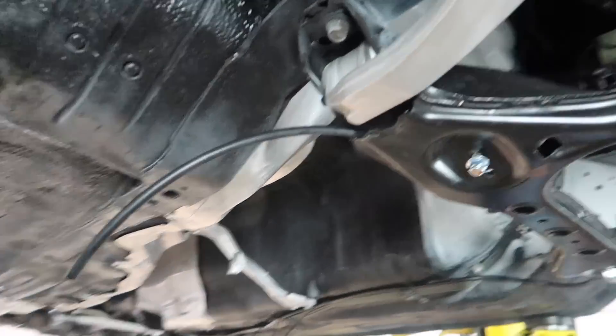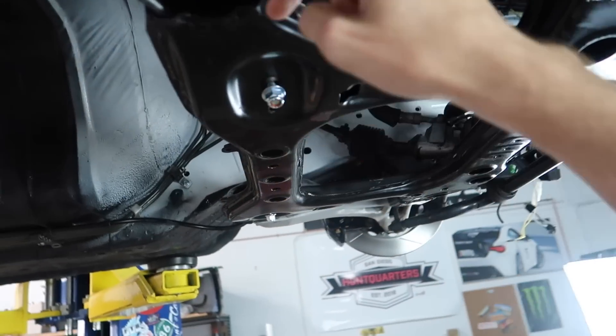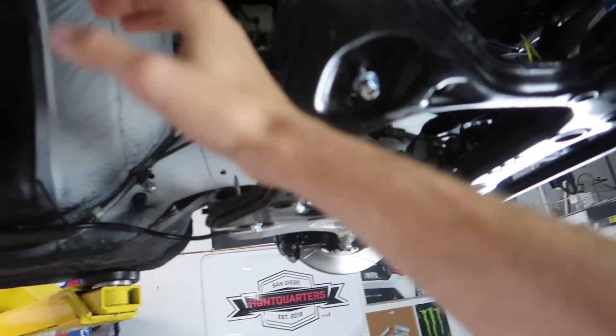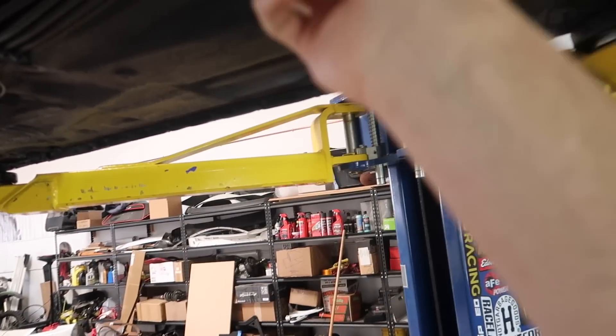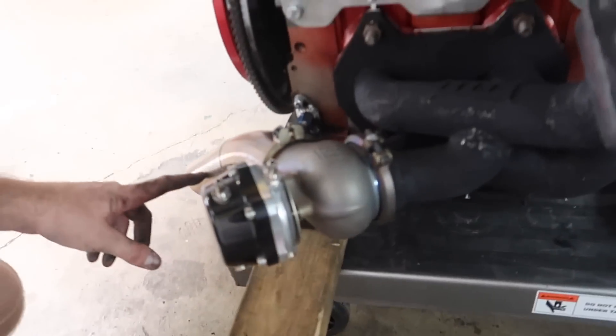Mickey just ran the front right airline from the front to the back of the car, which is pretty neat. He's running this airline actually through the subframe of the car — he drilled a couple holes on both sides and is running it underneath. One of the main reasons is because the downpipes are gonna come through right here, it's gonna get super hot, and we want to make sure that this line doesn't burst. It runs through to the other side of the subframe and then along with the fuel lines. Because of the dump tube off the wastegate, there are two very hot pipes right next to each other, so running it through the subframe will shield it with thick steel, and there are holes in that subframe so air actually moves through it as you're driving to keep it cool enough.